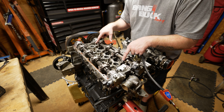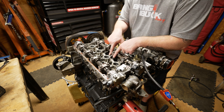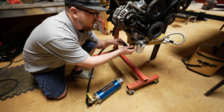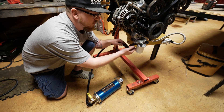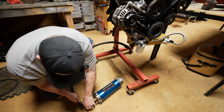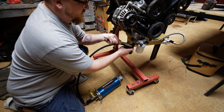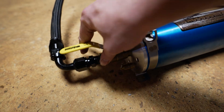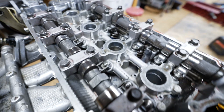When I open the valve on the AccuSump and let the oil into the block, I actually want to see the oil make it all the way through up the block to the head and coming out of the hydraulic lifter. I thoroughly brake-cleaned and blew out this line with compressed air. We're going to hook it up, snug these lines down. Moment of truth — we're going to open the valve. Pressure dropped. We'll watch it in the head.